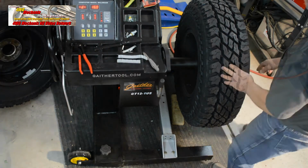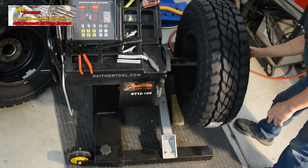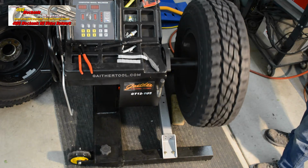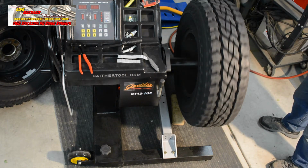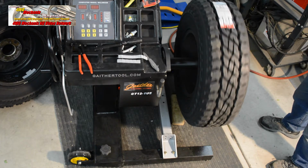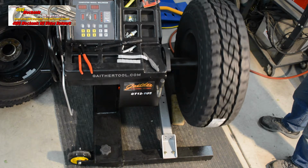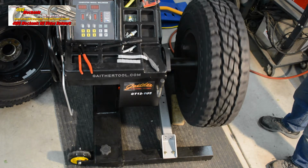And let's spin it. It does not take a lot of force on the spin. The balance in the spindle is such that a slight start like that will give it the 15-second runtime needed to get a data read. Slinging it any faster than that only delays the amount of time that the computer processes the information. So this lighter swing works just fine. You want about 15 seconds of runtime before you get a readout.